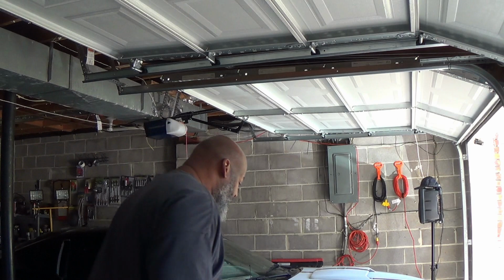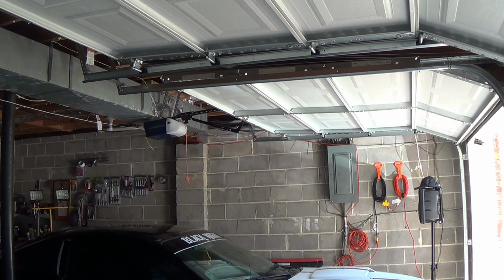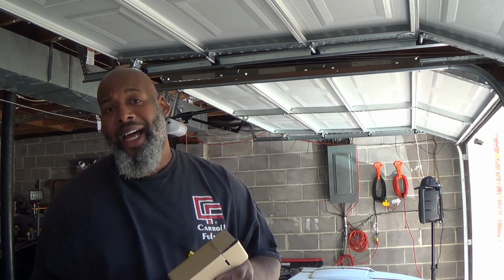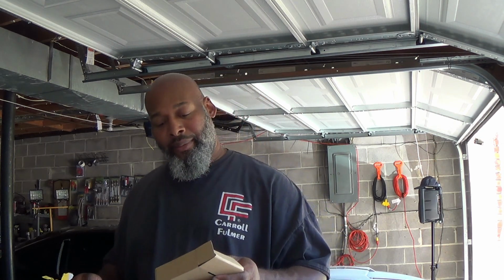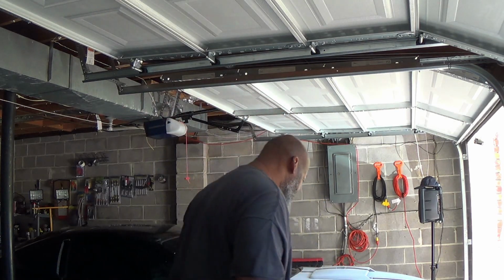I'm gonna finish that. But also, I wanted to let y'all know, because some people gonna ask what the clip size was. That's the wrong one. The clip size was a T5, in case you're trying to change yours. If you got a 99 to 2004, trying to change your instrumental panel lights, you will need the clips, which is a T5. And then the LED lights you need is a T5 too, also. Because the first time I ordered, it told me it needed a T10. And the T10 didn't work. They was actually too big. Actually, let's see. I think I got one on me here.